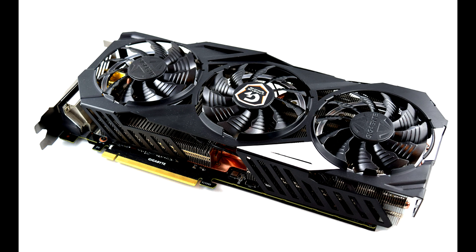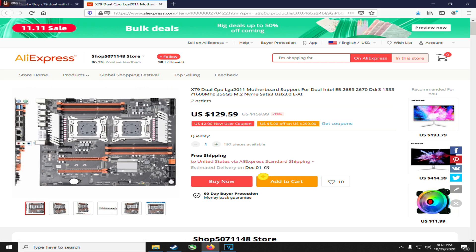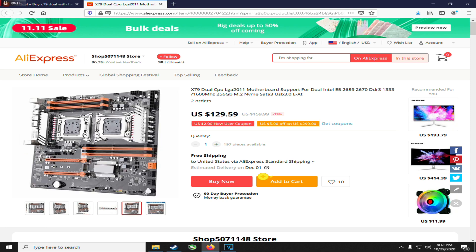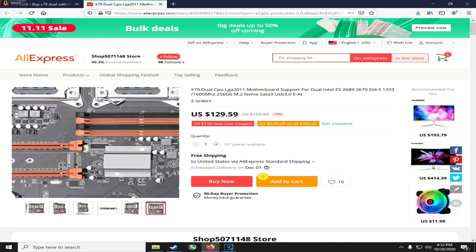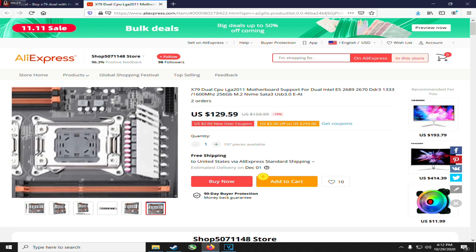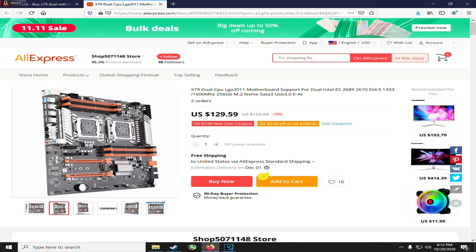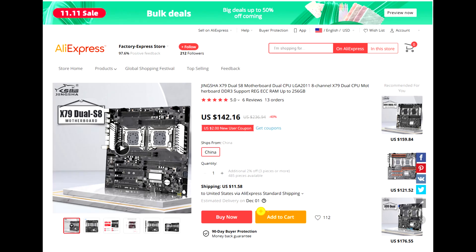Let me go over some things about this motherboard. It is dual-channel RAM — I needed to get that out there first because I know there will be questions. It is dual-channel per CPU, so it does have quad-channel memory in total, but only dual-channel per CPU. For everything else on the motherboard: it's got USB 2, USB 3, dual-gigabit Ethernet, PS2 ports, an M.2 slot, two PCIe x16 slots, two x4 and one x1. It is what you'd expect from a Chinese X79 motherboard, and it's not a bad board for that $120 price point. You can get quad-channel memory boards for about an extra $30 on top of that, so around $150-ish.